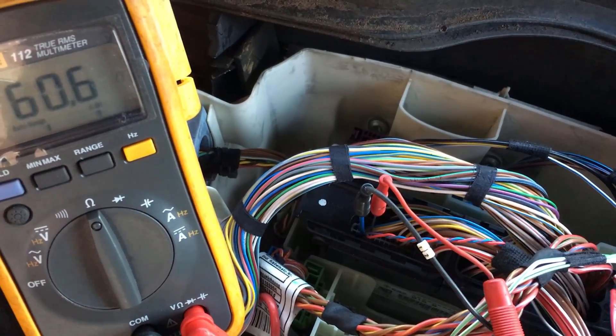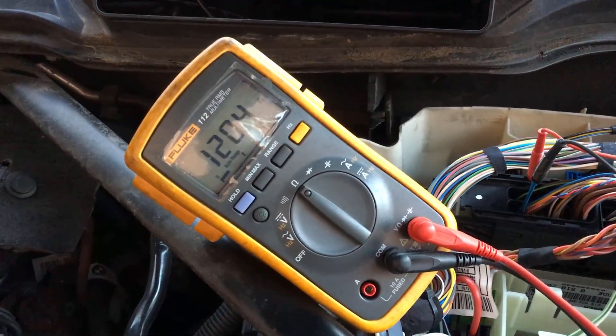These resistors are usually hidden in two of the control modules on the network, and they're there to help balance the network and stop reflection of signals — similar to the ghosted image you'd get with old analogue TVs. If you check the resistance between CAN high and CAN low it should read 60 ohms — two 120-ohm resistors in parallel. The theory goes that if you read 120 ohms, one of the resistors or circuits is open circuit. However, this test only actually checks the two parts of the network where the resistors are fitted — you don't know whether the rest of the network is okay.